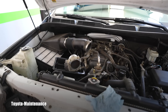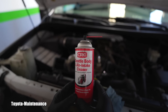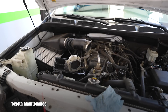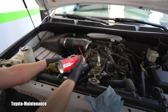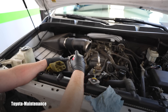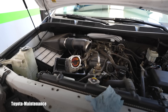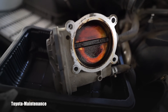I actually did the valve covers on this engine for this owner - I think I filmed that. As usual, I highly recommend CRC products throttle body and air intake cleaner. The other side is completely clean - I will start soaking this side. I'm not afraid that it will be flowing into the engine. Somebody who will not disconnect it will just be shooting it into the intake and can have a misfire. So I'm soaking it, and you can probably see it's already giving up - the dust and dirt is flowing away, and that was only after a few seconds of using that spray. It's potent.